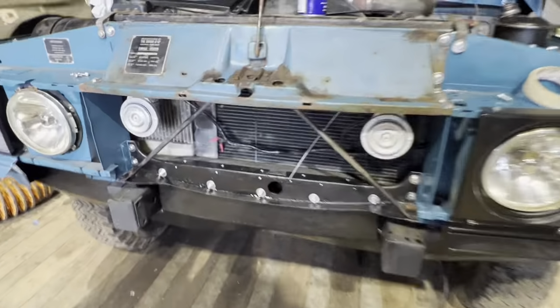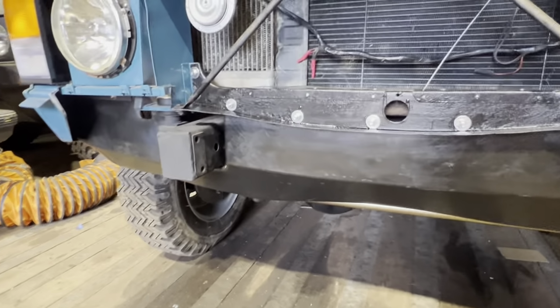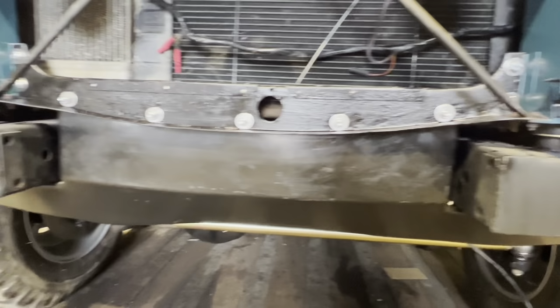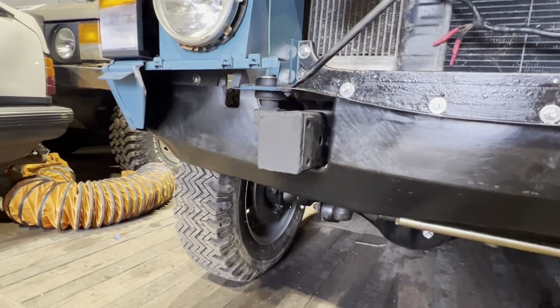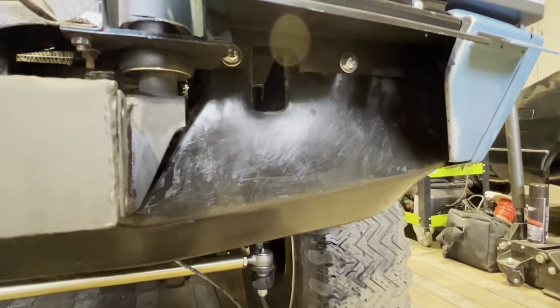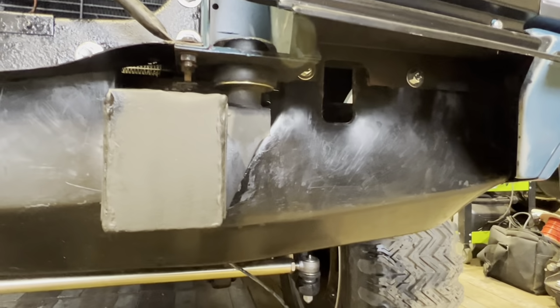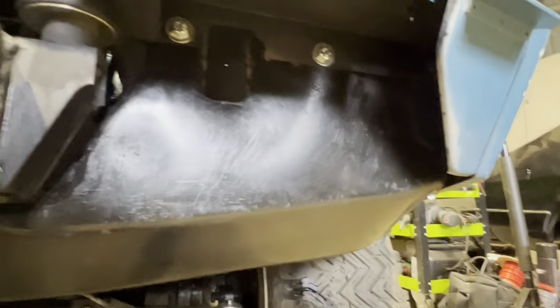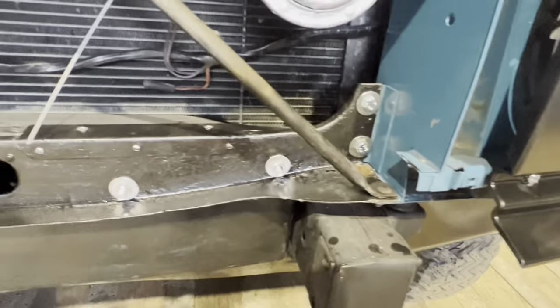All agree that's come out pretty well. So that's all the component parts bolted together and now bolted to the Range Rover. I don't really know why I didn't think it was acceptable to use this. I guess it's because all the mounting lugs were broken. But what I did is I actually just drilled them out to a larger size so I could fit a bigger bolt with a larger penny washer over them. But yeah, as you can see, it's all gone in, looks pretty good.